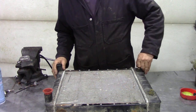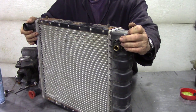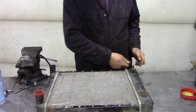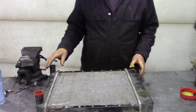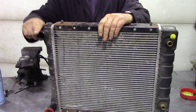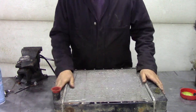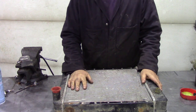First thing: the hose on here for the expansion tank is fragile. You break this off and it's tough — so just be careful pulling hoses on and off that. Second thing to watch: when prying hoses off these plastic tanks, you can crack this bit. Crack this and it's game over — they're very difficult to repair, and sometimes it's more cost effective to just get a new one.